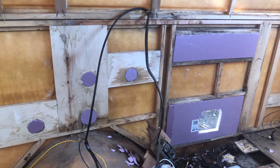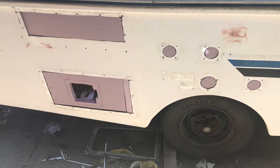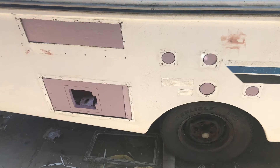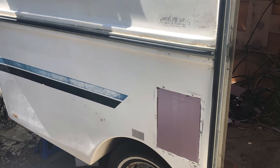All the things I pulled out — all the plumbing, the furnace, water lines, everything — I pulled out. Then I used foam board insulation to fill the holes because I wanted to use them as a template. The fiberglass I'm using can't actually go over the foam board, so I used the foam board as templates and also to keep the holes filled so no animals got inside while I had other things to do.